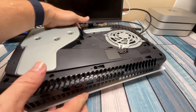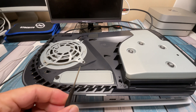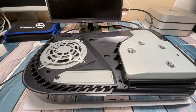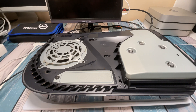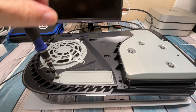At this point you're going to need a number one Phillips screwdriver. The screwdriver that comes with the drive kit is too small — it's perfect for PC screws, but Sony's PS5 uses number one Phillips screws. I've got the number one bit loaded into my screwdriver kit, which is my favorite kit for all my upgrades — I'll put a link in the description. Using the right size bit is important so you don't strip any screws.